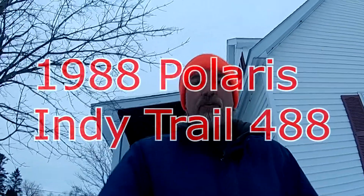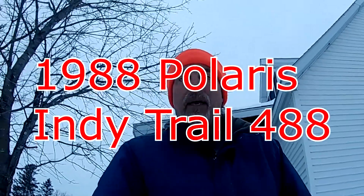We finally get a mild day — it's like 32 degrees out. Already been back from a little bit of a ride. One thing I wanted to check on was the oil mix for the snowmobile, because I had adjusted it about a half a turn more a few years ago. I have a video on that — more than what I thought was factory spec. I thought whatever the factory set the oil injection cable at, that's what it stayed at for the life of the sled.